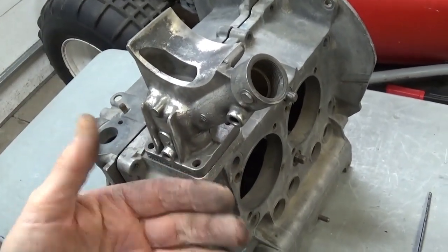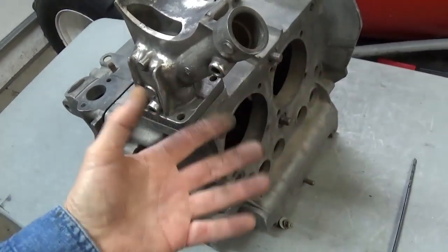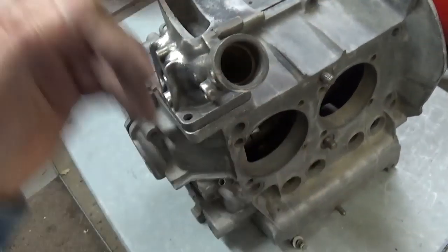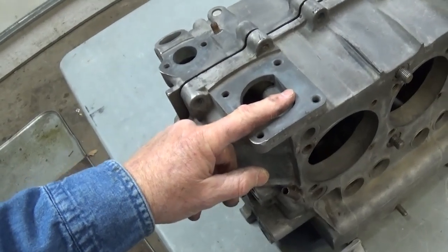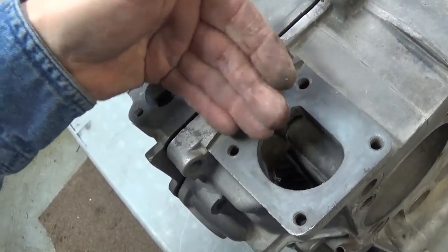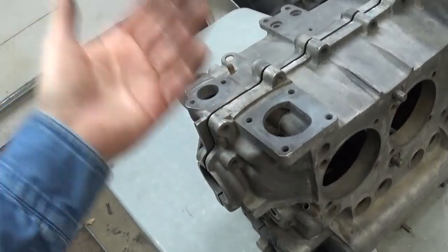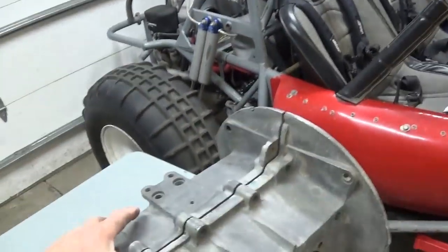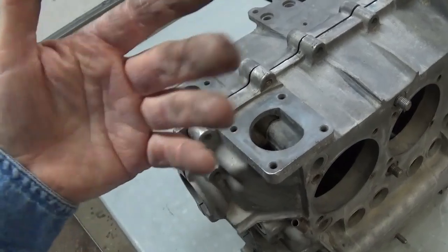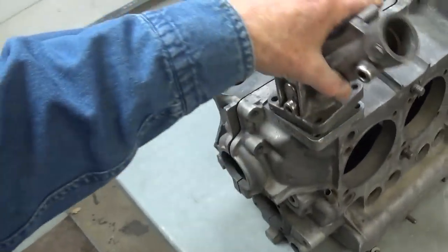I have owned engines over the years — as they get old, wear out, and lose their ring seal, you'll have them idling and take the oil filler off and there's always a mess. I've seen them so bad that oil was actually spitting up inside, probably because the baffle plate was not put in correctly. If you're dumping more oil in the area where the cam gear is, you're creating a surplus. On a daily driver, street machine, or off-road play buggy, you don't need all that extra oil there — it contributes to mess and creates issues with that part of the engine.